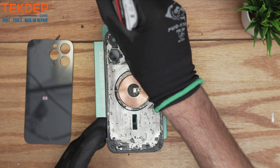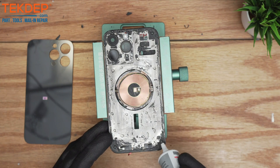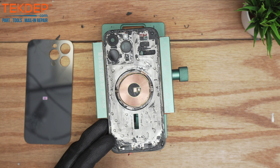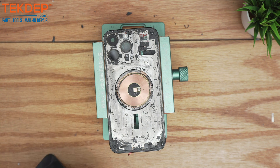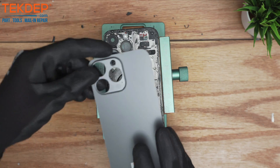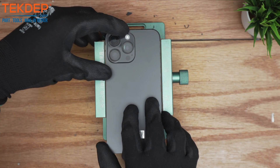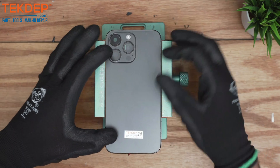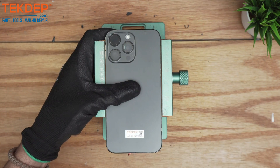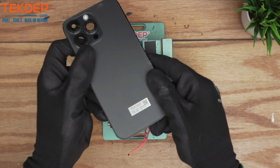You do not need to put adhesive in between the lenses. Do not use excess B7000 just in case something happens — like if it cracks by itself it's always good to give good customer service, so you'll want to replace it. But if you polish it the way I just showed it should sit right on without giving you any issues. You can always add clamps to make sure it stays on. Finally, inspect to make sure the back glass sits perfectly back on the frame.